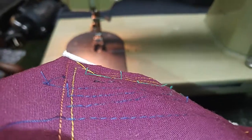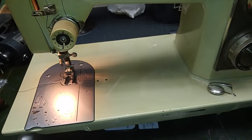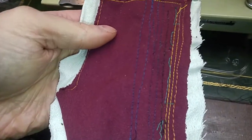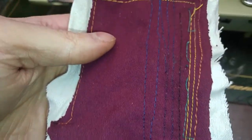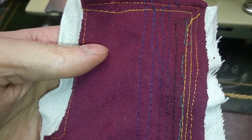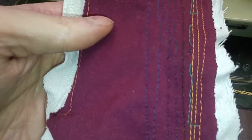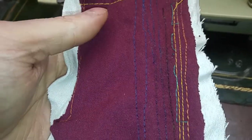I'm going to do the zigzag stitch, take two. I'll change my stitch width from one, then go to four and back. The zigzag function's not working — the only thing I'm getting is offset. It's like one and then four and back, and it just kind of worked its way. Just needle offset — something's not moving right in there. So I'll have to figure out what the scoop is there.